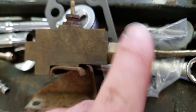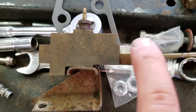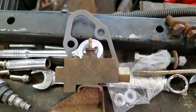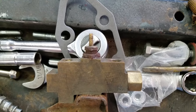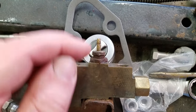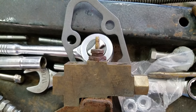One: this thing comes off on most of them. What you can do is, if you have the rear line below, you can actually take a needle and push it in from that side. If you push this thing over one click, it centers. Another option I had to do on the GMC out there — this switch threads out, and then you'll be able to see the piston. If you're lucky, you'll see the little groove that the nib on the sensor rides in — there's like a V cut out of it. You can take a pick, go in there, and try to move it back. I kind of got lucky on that one because it wasn't pushed all the way over. If you push it all the way over, you probably can't get to that little groove anymore.